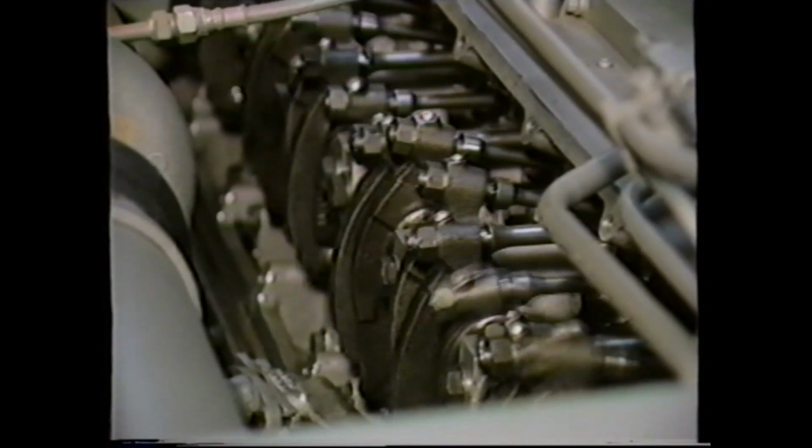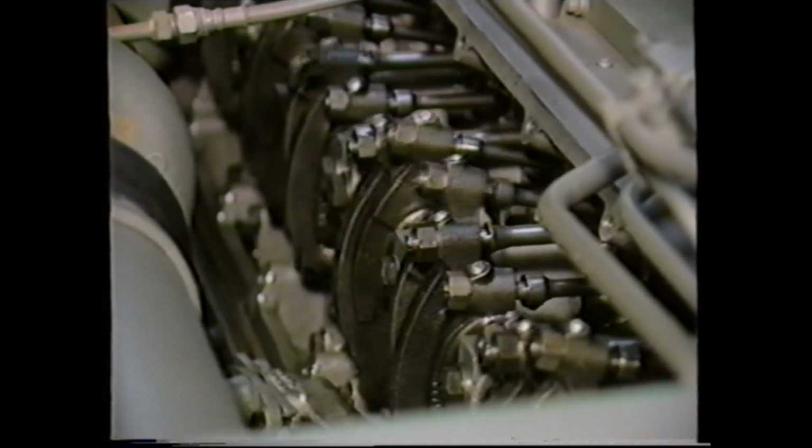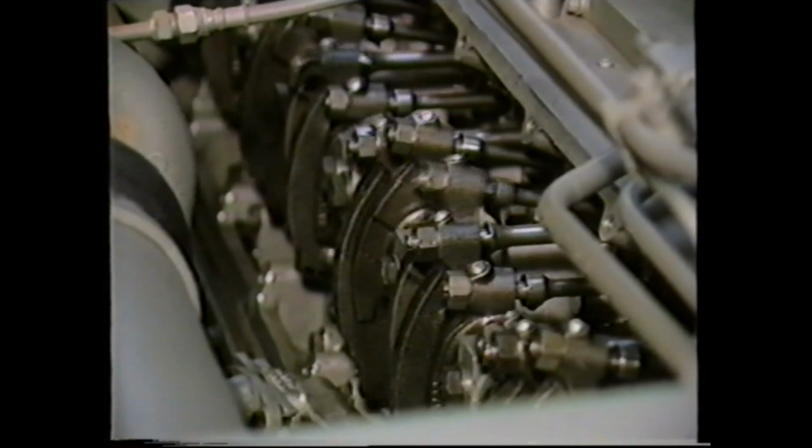If you wish to locate the faulty injector and no special equipment is available, you should proceed to substitute each injector in turn with a replacement injector. If the engine shutdown is checked at each stage, when the faulty injector is reached, the engine will shut down normally.